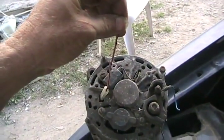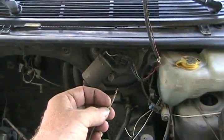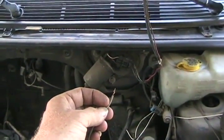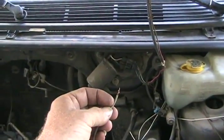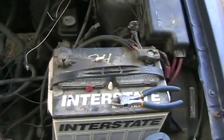That was here on this alternator. But now for some reason it blew my wiper fuse. Every time I put one in — but not when the car was turned off, the wipers worked great — start the car, the wiper fuse would blow. But every time I started the car after changing the fuse, the alternator still worked perfect. Great voltage reading, 13.79. So every time I started the vehicle, it sent a quick pulse of 12 volts to the alternator which excited it, and then it just kept working, but then the circuit would blow and the wipers wouldn't work because the fuse would be blown.